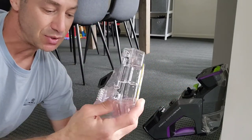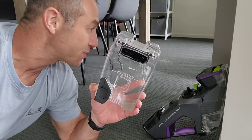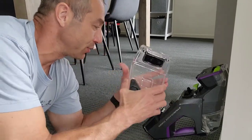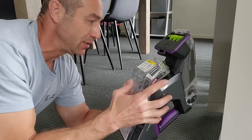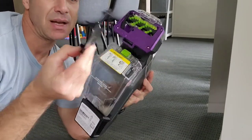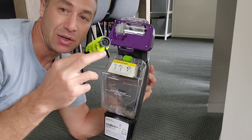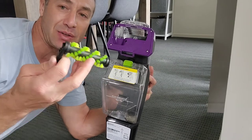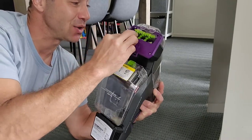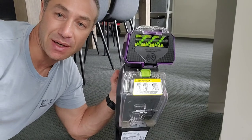To empty the dirty water, there's a rubber seal — you peel it out and empty it. Done. Because we didn't use much of the brush there's no need to clean it, but I'll show you now. Put the reservoir back in — nice and easy. To clean the brush, just unhook it from the bottom: the cover comes out and then you pull the brush. If you've got pet hair, clean it around; if not, just wash it under water and check the compartment for anything stuck inside. Close the deck and clip — that's it, appliance is clean.